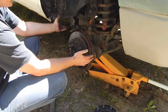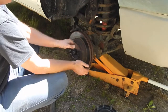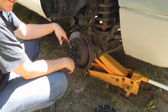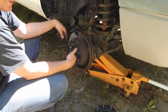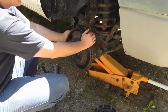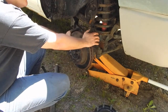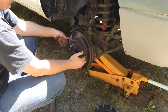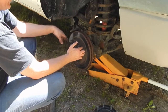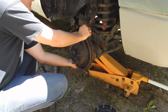With the caliper completely removed, just give your rotor a spin and listen. If you hear anything really bad sounding as far as the wheel hub bearing assembly, that's the time to replace it — and that time would be now. Also, any clinking or clacking you had on this side, you're going to be looking at that universal joint on the axle. If all that checks out, like in my case here, it looks like all I really need to worry about is the ball joint — and that lower ball joint is really sloppy.